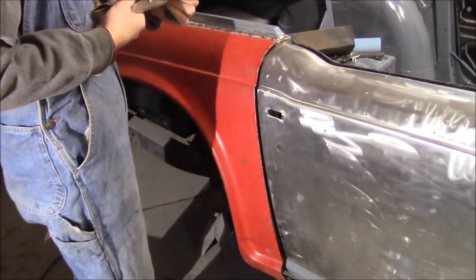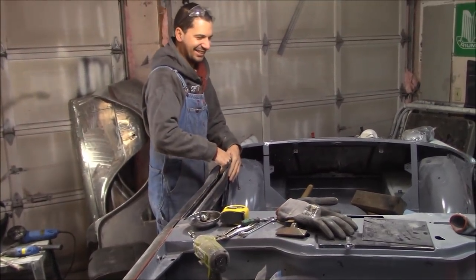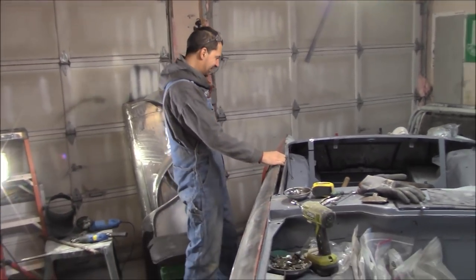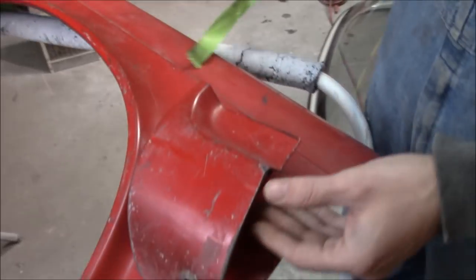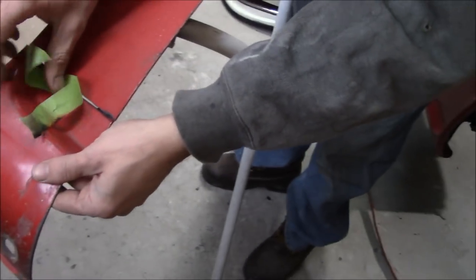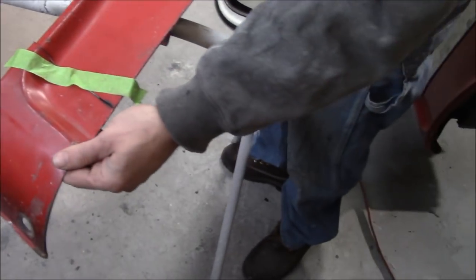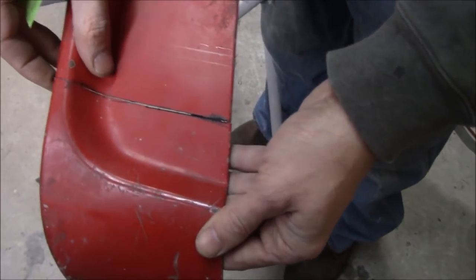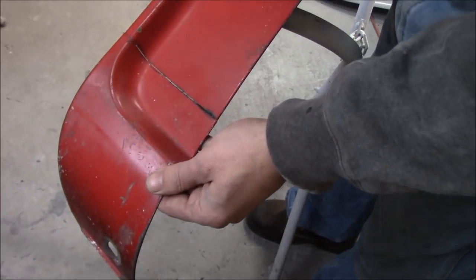Anyway, we've got to do what we've got to do. Technically I said I wasn't going to cut the red fenders, so that means you have to cut the red fender. You're going to be the bad guy in all this — you have to not screw it up but you've got to make the first cut. All right, so the fender's cut. This is how much we've taken out of it. We're just going to tape it back together — we've got the green tape, we don't think that'll stand out too much. We'll just tack it there and be done with it. There's no going back now. We'll line this up best we can, probably grind this a little on this edge. We'll bring it over to the passenger side, fit it up and tack it as required — this is how we're fixing the car.